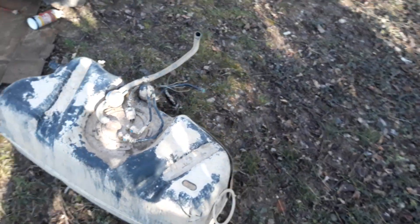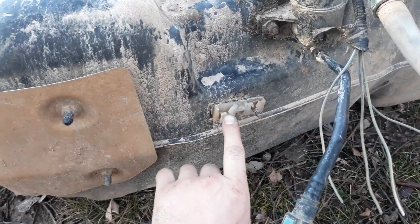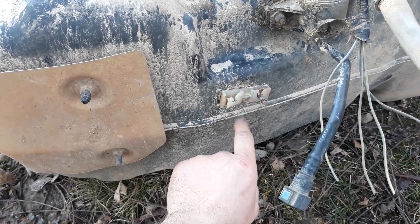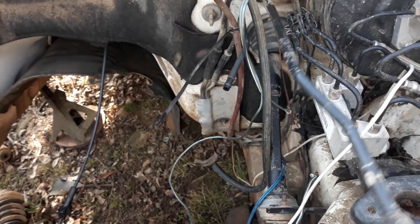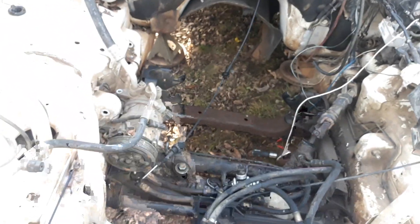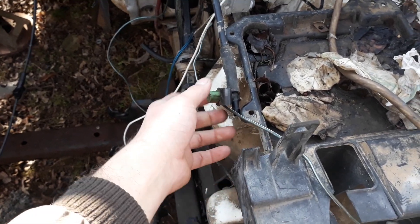One of the sensors you're going to need — and potentially the whole gas tank — because I don't think this mount here is the same on the new style Jeep. You're going to need the sensor that was here. You're going to need some vacuum line — I do believe this one is on both vehicles already but this one isn't. You can pull that off the donor or just buy some. I bought some air brake tubing — it was black and plenty stout enough for the job. You're going to want to take this solenoid — it clips onto here — the Jeep's pretty old.